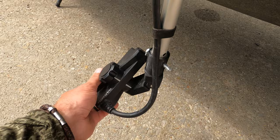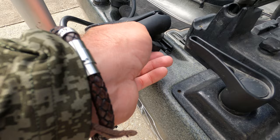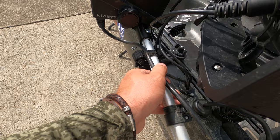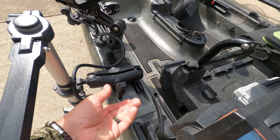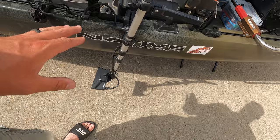You just use the tape they provide to attach the wire to the mount. It uses a two-inch RAM ball mount. If I'm in shallow water and need to get the transducer up, I just twist it to loosen it and secure it to a Yak Attack paddle mount right here — it just sits there until I'm ready to use it. When I need it, I pull it out, drop it down, tighten it up, and I'm good to go. You can spin your kayak any direction to face the fish, so as long as the transducer is stationary you're set.